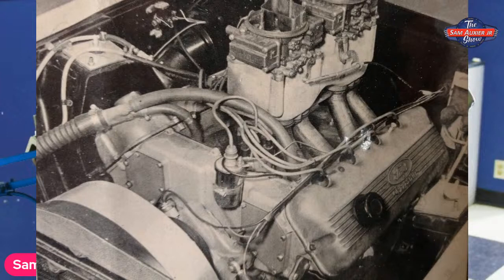Vic Edelbrock made this, and it's got an injection manifold plate under it. And this was all, believe it or not, steel tubing, aluminum plates, and an aluminum intake plate, injector plate. Now, obviously, you couldn't weld all these together, so Vic fiberglassed it together. So it was fiberglassed, but it worked. And I don't have to tell you, I think we picked up probably a tenth and a half, maybe two tenths with this intake. I mean, it was just night and day with the car. It was crazy. But Vic did a fantastic job.